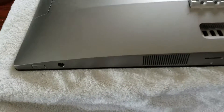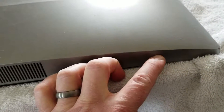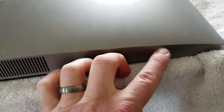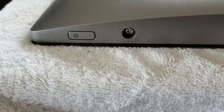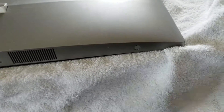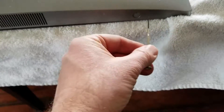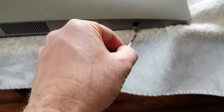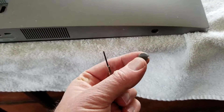What we're going to do to remove the back panel is access two screws on the bottom. They will be covered up by these little rubber sealers. I've taken one off the left side already, where you can see a Phillips head or regular flathead screw. To pop these rubber sealers off, we're going to use our little flathead — just come in here and pop it right out. You can use a pen or any other small object.